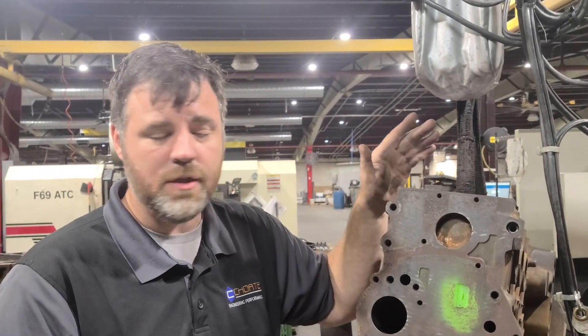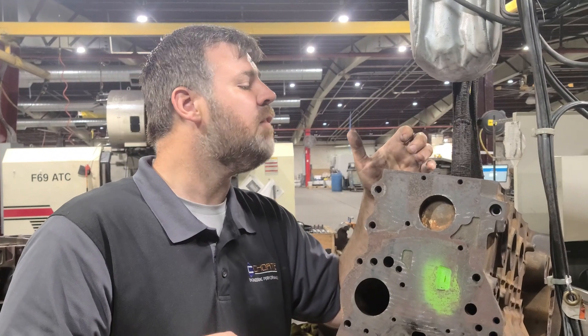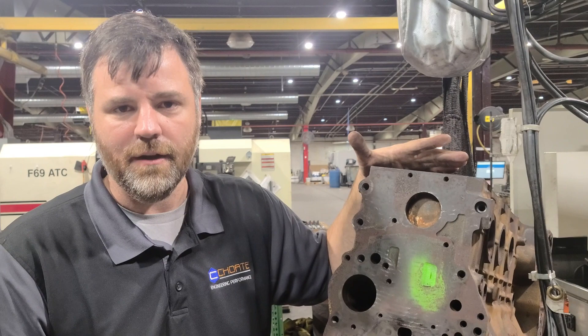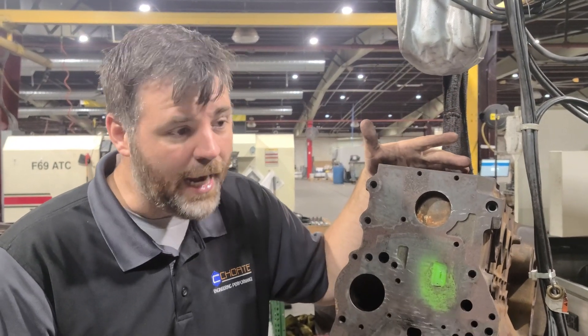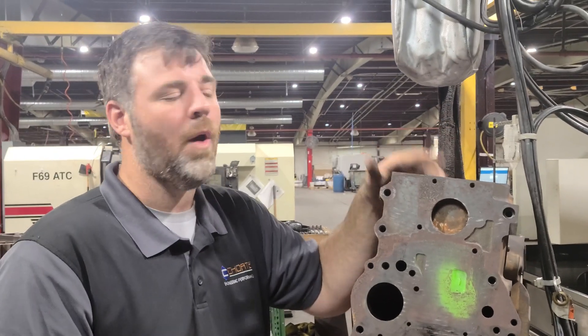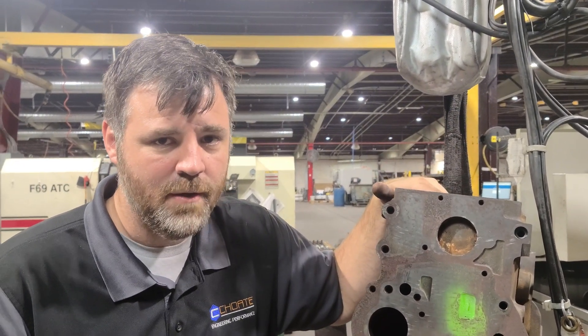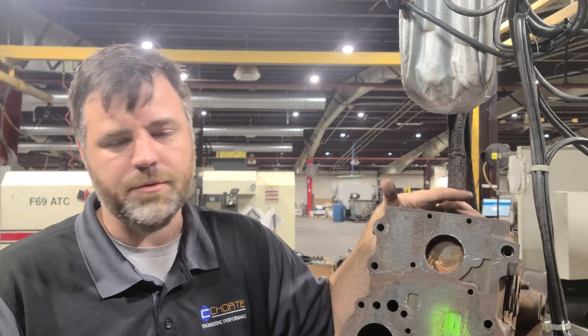Not just the cylinders, but the radiator too. All your flues in the radiator itself get stopped up. What it does is cut down on the cooling capacity of your engine. It runs the cylinders hot and it costs you a lot more money, and you wind up destroying things. You think you're fixing something, but please quit doing that. It stops up your oil cooler and just wreaks havoc. Once you put that stuff in your engine, it's there — forget it. Trying to get that out is a nightmare. You can try to flush it till you're blue in the face, but you'll never get it all out. Once you put this stuff in, it's done.